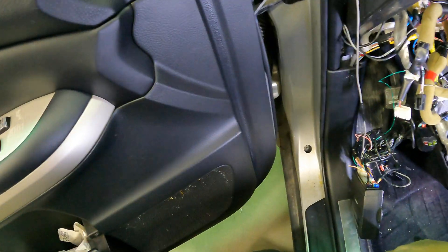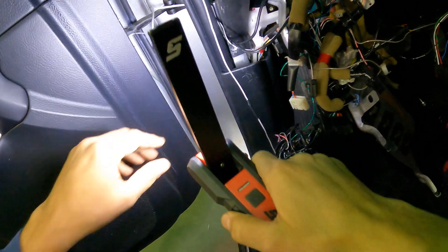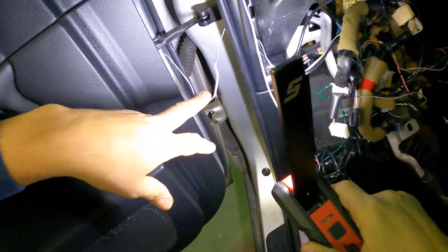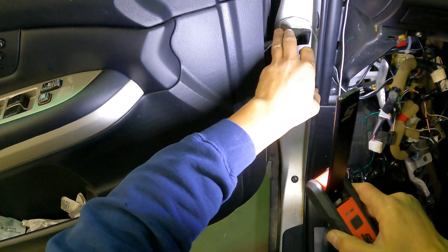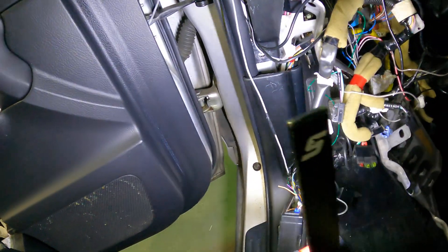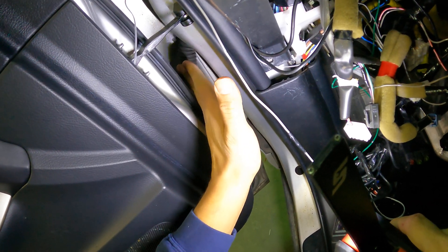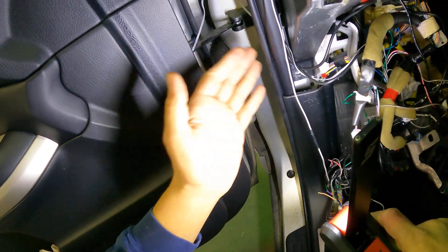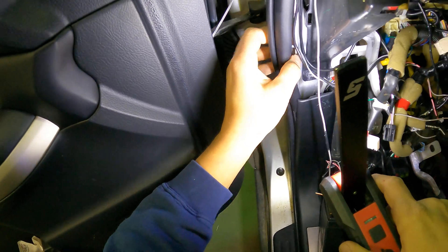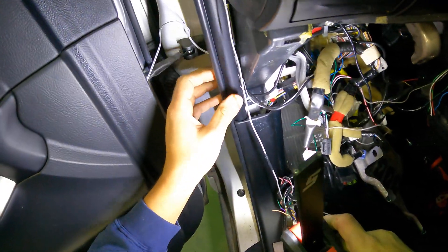The last thing we've seen is the connection to the power lock in the vehicle. We have the power lock in the driver door and there are wires that have to be run from the power lock to the driver door. The wires are run, again, not to our liking — they're external, you can see the wires, they can get cut and damaged. It doesn't look good and it's not a professional connection because this can break very quickly. The vehicle has the door boot where the factory wires go between the body and the door. The proper installation would be removing the door panel, running the wires through that boot into the vehicle — nothing visible outside, nothing can get damaged. In this case the wire is actually squeezed on a sharp metal bar, so it can obviously get damaged very quickly.